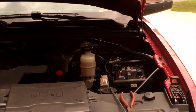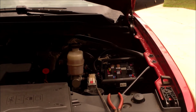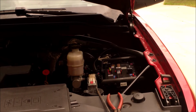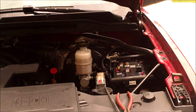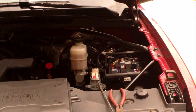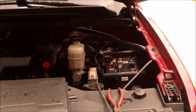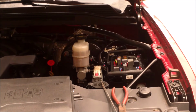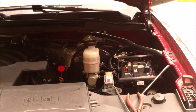This is a fault that's with GM. It's a very complicated system. Ridiculous to have BCM control two relays, a switch, a rheostat controlling BCM, BCM controlling two soldered in relays that you can't replace. Ridiculous. The box itself, the fuse box, is around 150, somewhere in that area. But you know, it has to be done if you want high-speed wipers, and I do, because we get torrential rains here in Florida, and we need that high speed.